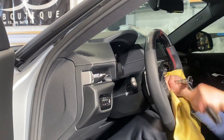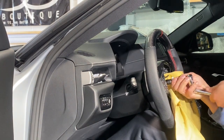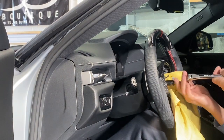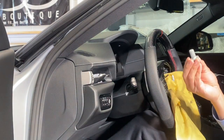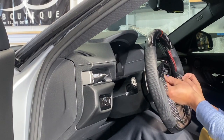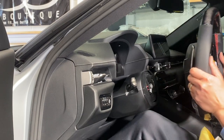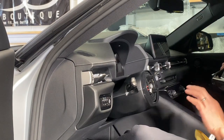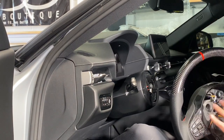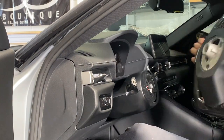Put the 16 mil on and press down — it'll break loose. The reason the bolt is so tight is because Toyota uses thread lock on the bolt, so make sure when you put the bolt back in you use thread lock as well. Once the bolt is removed, set it aside, remove the towel, and unplug the ribbon cable. There are two cables — unplug both and the wheel will slide right off.